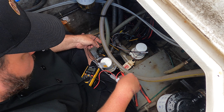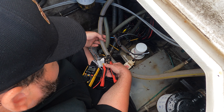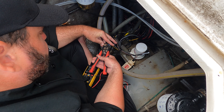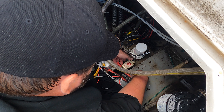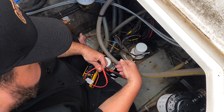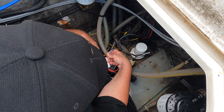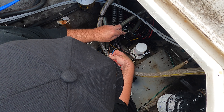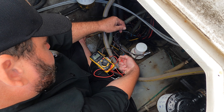I still have the ground. I'm gonna cut into the other side of the float switch. This side was the power from the battery going to the float switch, and when the float switch goes up it transfers power to the power side of the bilge pump. I've got the float switch up, engaging the power, and we're gonna see if it transfers. Here's the power lead on the other side of the float switch — checking power. I got nothing, zero. That leads me to believe the float switch is bad.